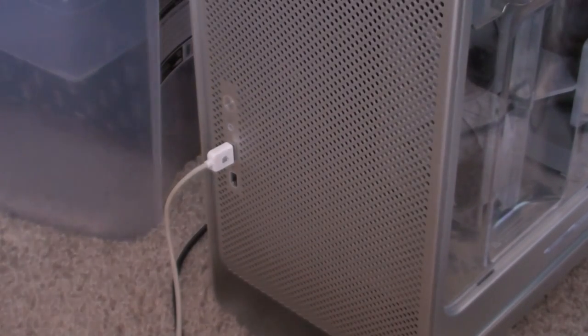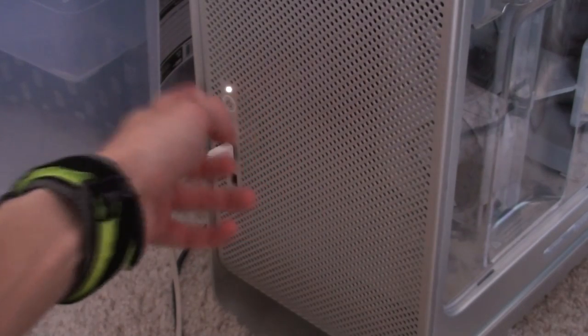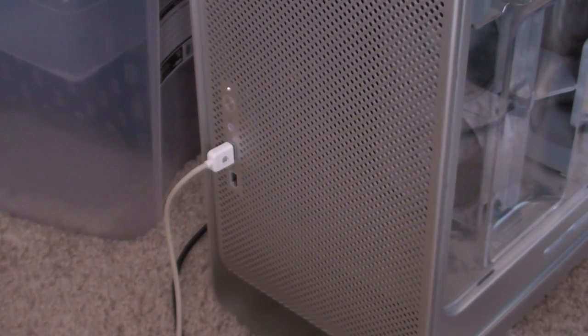Alright, all the RAM is out of the machine, the fans are back in, and the thermal thingy is also in position. Normally, if there's no RAM, it should just beep. But we got one blink. One blink. So that's different. But then that also invalidates this entire list of blink codes that I have, because there isn't a code for one blink.